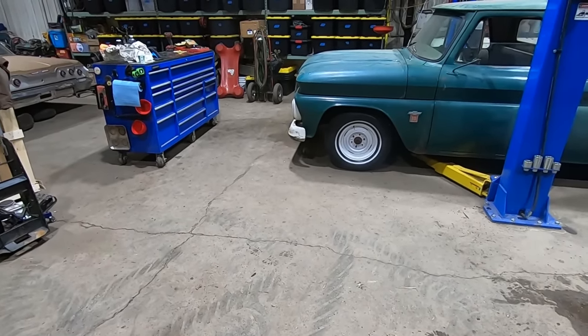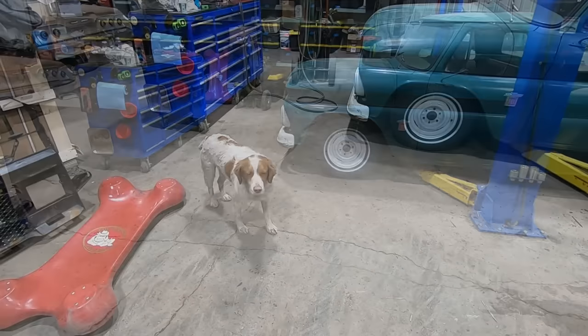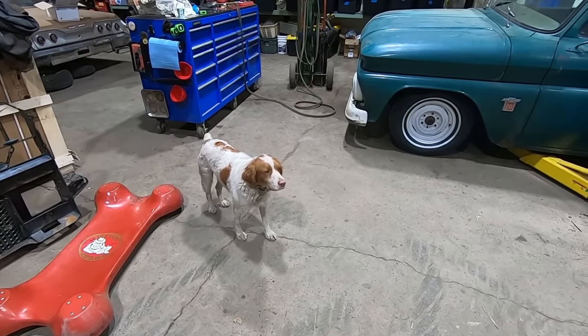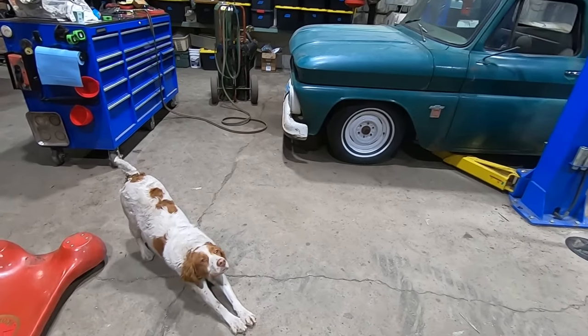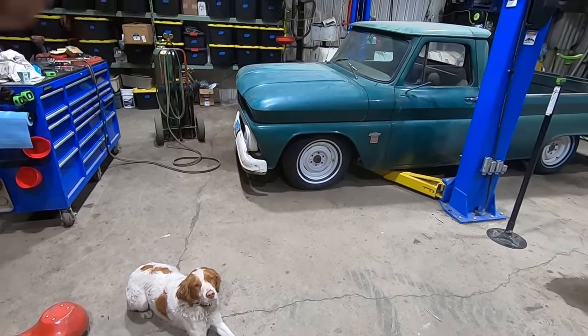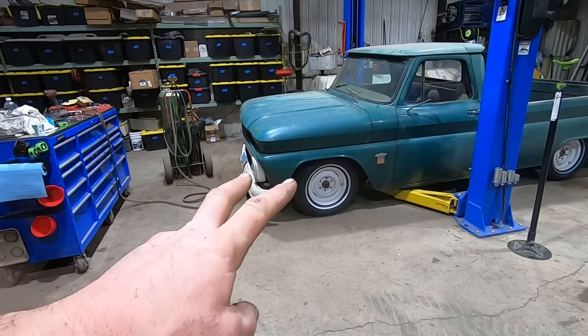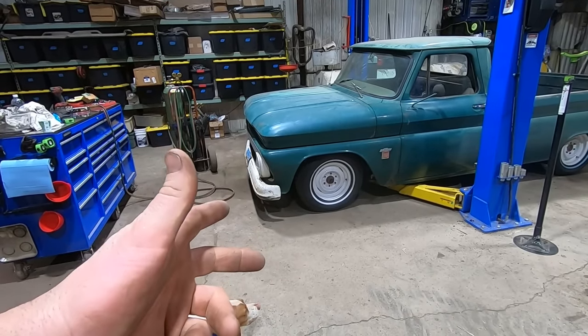All right, I'm gonna jack her up, cut in the coil, and see what happens. What do you think, Duff? You approve, huh? Two coils cut. He says, yeah, you gotta get her low in the front. I measured from side to side, and it's about 4 1/2 inches difference, so two coils. 4 1/2 inches, roughly what we got.